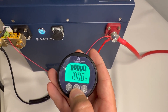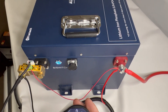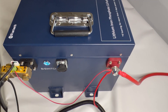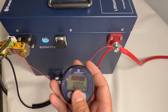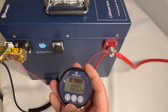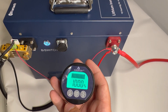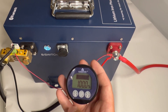If you're not going to be using the cart for five or more days, you can power the battery off. However, this will reset the state of charge meter and the same steps need to be taken: charge it to a hundred percent, set your amp hours, and hit the hundred percent setting. If you do not turn off the battery, your settings will be saved even if you turn the cart off or put it in run/tow mode.